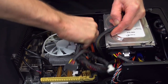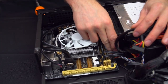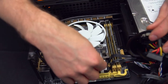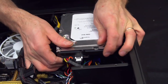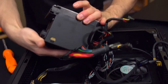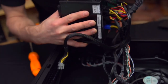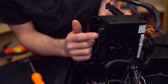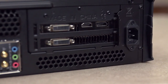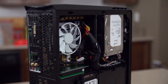There are six SATA ports on this ASUS Z87i Deluxe motherboard, though I used a right-angle connector which wasn't ideal. Silverstone has excellent user manuals and they need them because you have to do the build in a specific order — you must install the power supply before the hard drive and then install that whole assembly together. The SFX power supply has an extension cord that runs from the back of the case to the power-on connector, routing around the outside of the case in a very tidy manner. The hard drive then screws onto the cage.